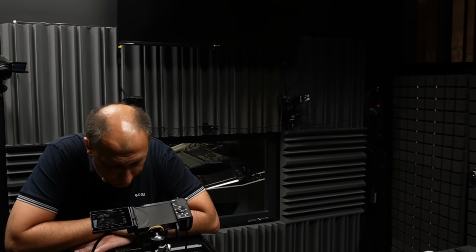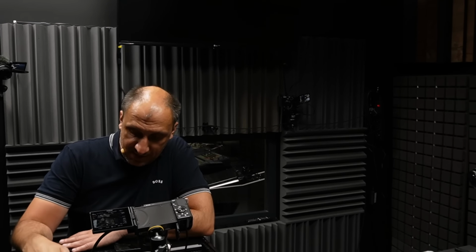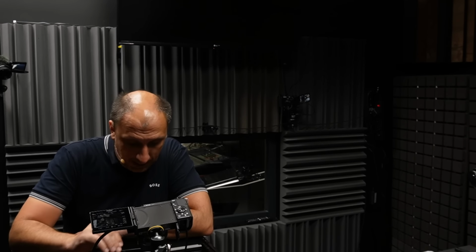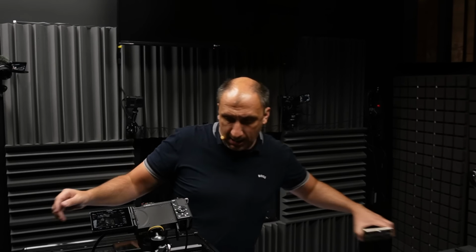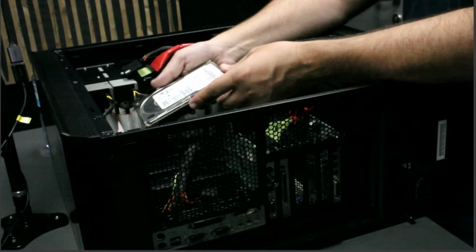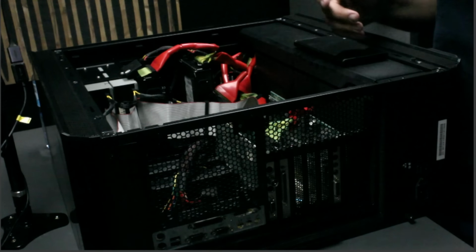Furthermore, we have a couple of other really exotic components here. We have a couple of SCSI disks. These are actually LVD, and I have an LVD terminator. Those things were very expensive back in the day, and don't even get me started on the cables. Cables were insanely expensive, especially the external ones, a topic for another day. These are two 73.6 gigabyte, I think, discs, and I have another one that I still haven't put inside, a SCSI 73 gigabyte IBM disk that I could also use, but currently I'm not using it.